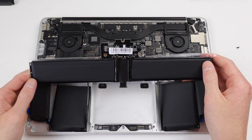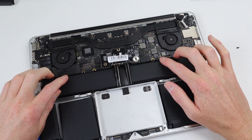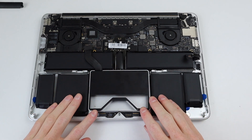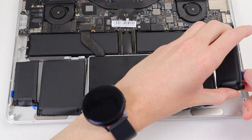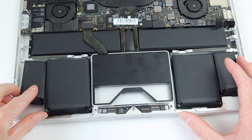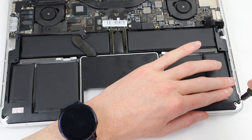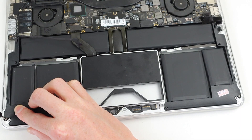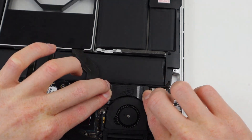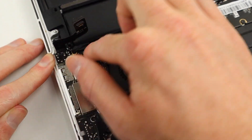It's time to crack out our new replacement battery and get that installed into this MacBook Pro. The top portion is actually screwed into place, but the bottom is only glued. For our screws, I had to salvage some and I found some in my parts bin, which are actually from iPhone 4Ss — they're all the same size and worked perfectly for this use. With the top portion of the battery in, all that remains is to get the lower half seated into position. Adhering it down into place, I can then attach the speakers. I'll reuse the bent screw for the speaker as I couldn't find any replacements. I did find screws to fit in the lower section, but couldn't find any for the upper part of each speaker, so they'll be missing one screw each. After they're fastened into position, I can route and connect each cable.